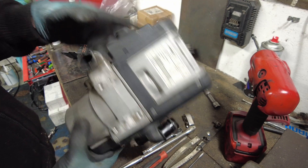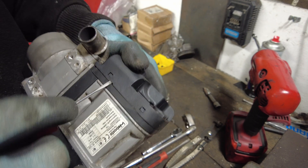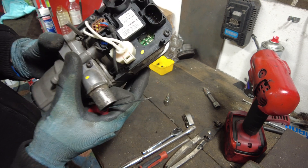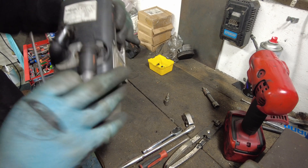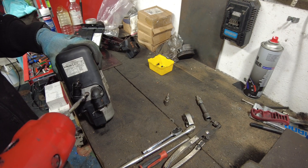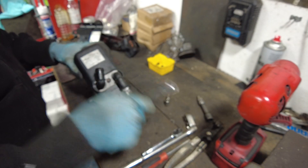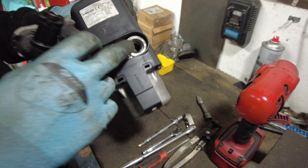So I've got to take these covers off either side, which have little plastic tabs. Just pry them up — that opens up the electronic side. On this side you've got to take the coolant outputs out. One T25 bolt down the middle, and one O-ring seals in there.